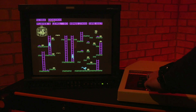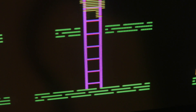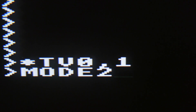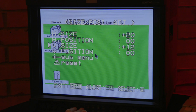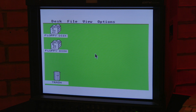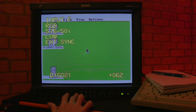On the BBC Micro most games run in an interlaced video mode, so there's a little bit of flicker discernible. However, Chuckie Egg still looks amazing and it's probably my favourite game of all time. In modes other than Mode 7 you can switch to non-interlaced scan, which demonstrates that you can reduce flicker and enhance the scan line definition. Plugging up my Atari ST we suffer the usual hefty border around the screen. This monitor allows you to adjust the horizontal and vertical image size so you get more CRT for your money, but you've got to delve into the service menu for full control, which allows you to totally eliminate the borders.